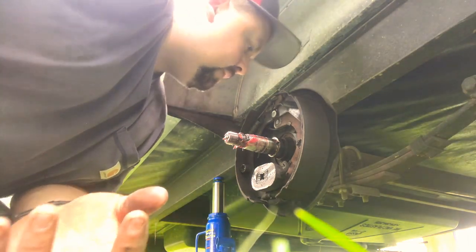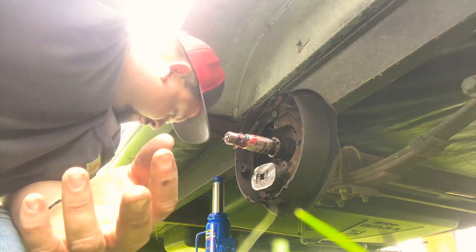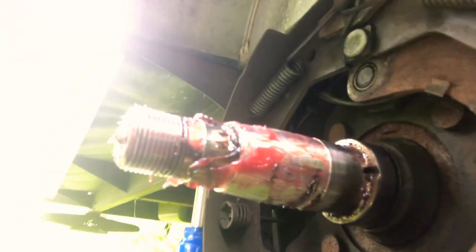The spindle looks pretty good — there's no burn marks or real nasty abrasions. The inside of the drum is sort of the same thing. Sometimes if your bearings get hot, which isn't uncommon, you'll get some brown right where the bearing rides. This one here is a little dirty but not as bad on the other side. I've probably packed these bearings twice in the 12 years I've owned the trailer, but I don't put a lot of miles on it.